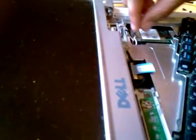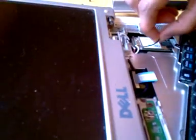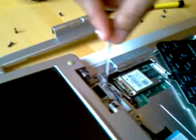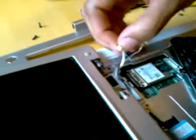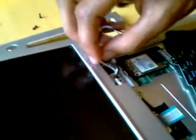First, we'll start with the wireless card connections. You just want to wiggle it, and then it'll snap right off. You'll hear it snap just a little bit. If you snap it too hard, you're going to break it. Be very gentle. Just like that, and the LAN card's disconnected. You pull up the other connection, nice, smooth, and easy, and you're all set there.